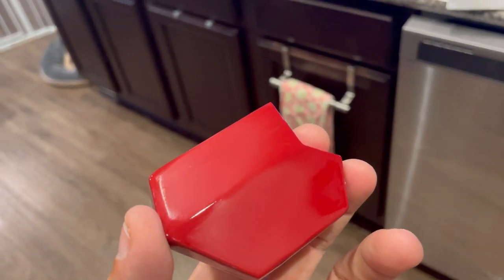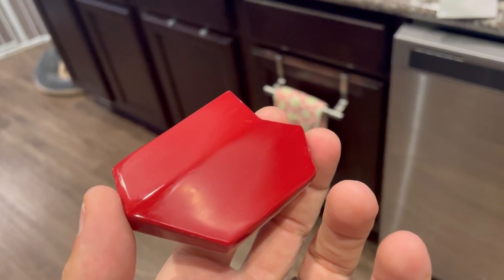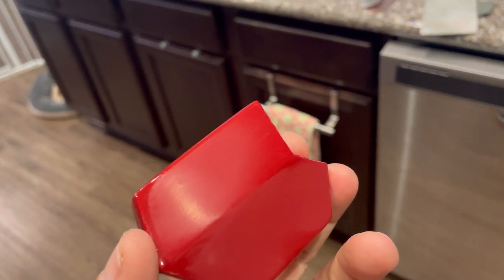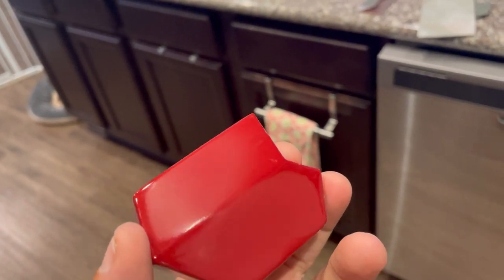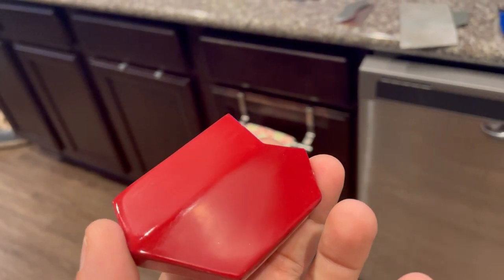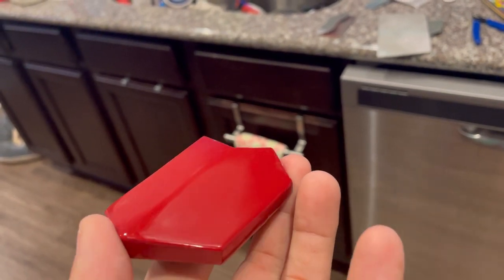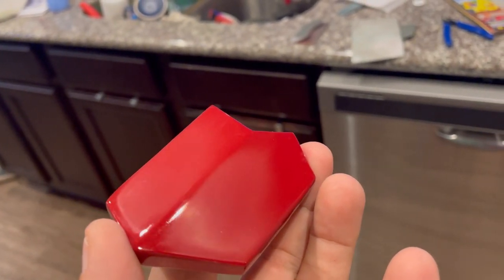This is that small earpiece that had those two little imperfections. After wet sanding, it's a little bit visible, but we're going to re-clear coat this and you will not even notice it was there. This is where some paint came off, so I'm going to do two more coats. I had to go with some 600 grit to knock down that little dimple area where I put the bubble of clear coat. So I went 600, 1500, 2500, 3000, 5000. Once the whole thing's clear coated, you won't even really notice it.